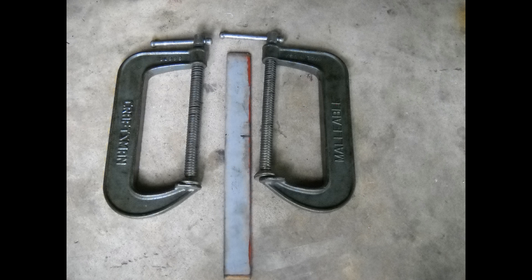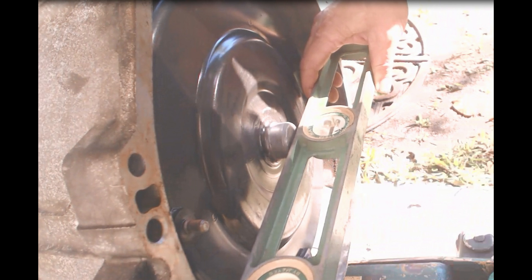In regard to the squeeze-o-matic tool, I actually managed to use two large C-clamps and some shortened wood blocks made out of quarter-inch by one-inch wood stock to take the springs and snap rings out of my transmission — they operated in much the same manner. The slotted table made a big difference in making it easier. I'm not going to show you how I did this because it can be extremely dangerous, especially with the large spring in the reverse drum, but it can be done. Just take your time, go really slow, and tighten the clamps very slowly on both sides to get equal tension as you take the springs loose. Thanks so much for watching and I'll see you in a future video.